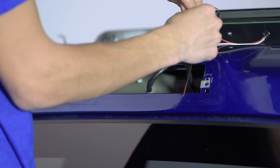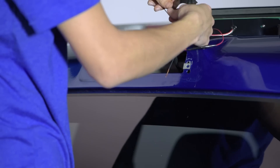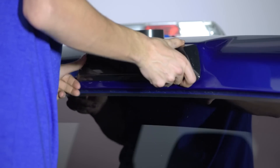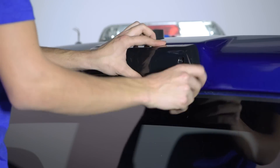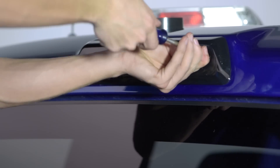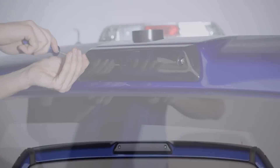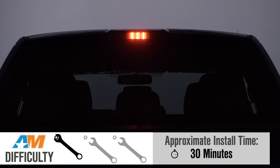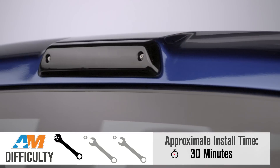For this, you're basically using a Phillips head screwdriver to remove and replace the factory third brake light with the Recon option, and for the wiring you're looking at your favorite set of wire strippers, crimping tool, or a soldering iron. Even though there is a small amount of wiring needed for this install, it's very straightforward — one out of three wrenches on my overall difficulty meter, and no more than 30 minutes from start to finish.